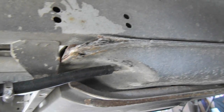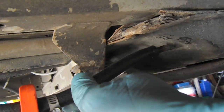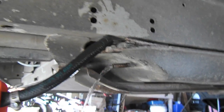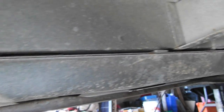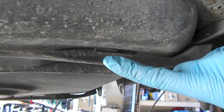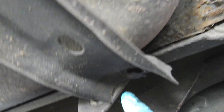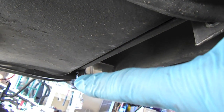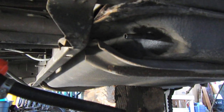First thing, I'm just going to drain the tank. The tank is pretty low — you don't want to do this on a full tank. Next, while that's draining, we're going to undo the support brackets. I'm just going to loosen them up. There are two 13mm bolts: one right here and one right there for this support bracket. The tank is finally done draining.